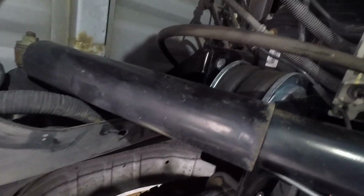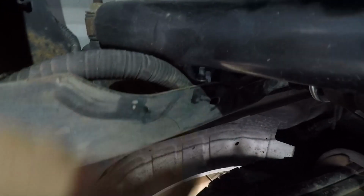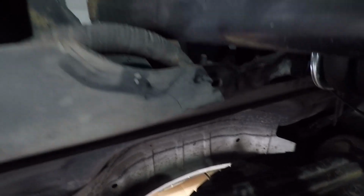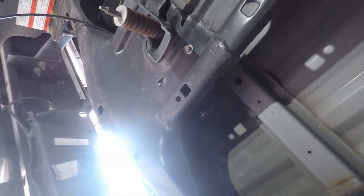It's kind of hard to show you running it, but literally just find wire loom, make sure it's not pinching on anything. Like you wouldn't want to tie it to this loom right by the shock. It might rub on the shock and go through. But on the inside of this would be perfectly fine. So just be smart about how you're running it. Make sure it's not pinching anything. And then we will get back once it's done and we'll fill these airbags up.